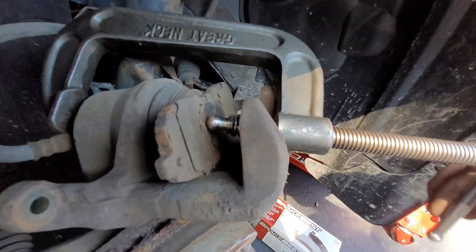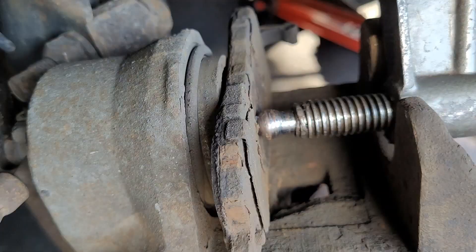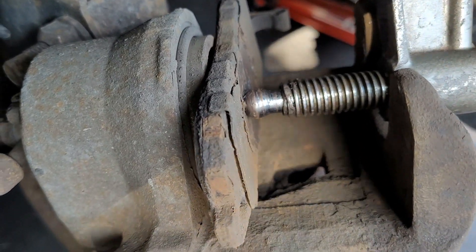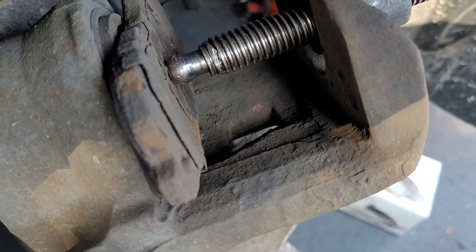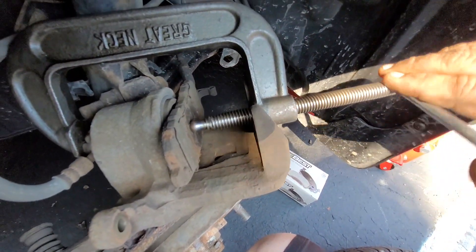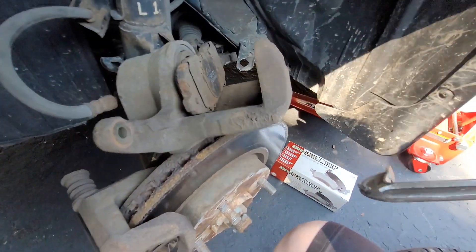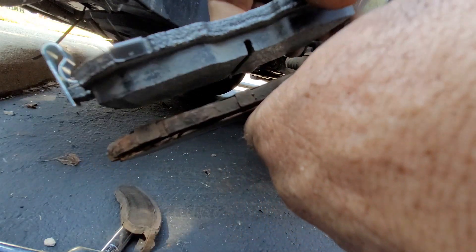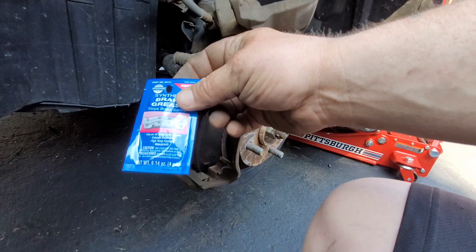Now that we've got both bolts off, we're using a screwdriver to push the piston in a little bit so we can get the caliper off. Once we have the caliper off, we take off the brake pads — these old ones were completely gone, I mean 99% gone, all the way down to the metal. Put the old pad up on the piston to push it in with the C-clamp — nice and slow, do not do it fast, take your time. You don't want to bust the rubber around the piston. Now I'm going to show you the difference between the new brake pads and the old ones — as you can see, there's a major difference.